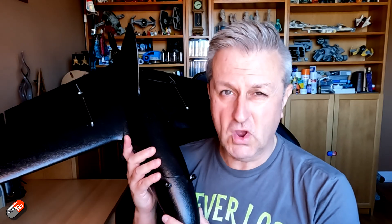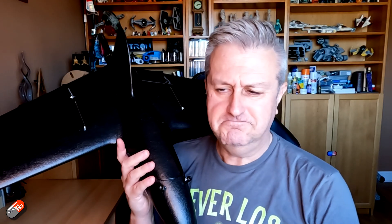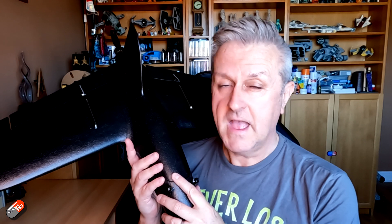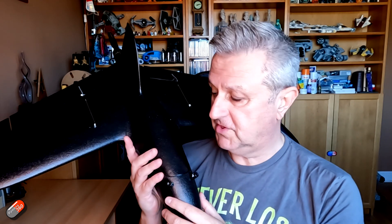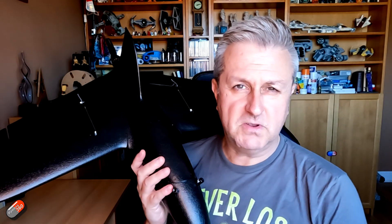It's one of the things I love about INAV - it means that my launches are safe and work every single time. Auto launch won't protect you from a really terrible throw, but if you give it a good throw into the air, it'll catch it and climb like, as my friend says, a homesick angel. The issue is that when you arm the model and it's in auto launch, you'll hear a beeping noise. And when you raise the throttle so that the system is ready to be thrown, you'll hear another noise, and while that noise is going on the prop potentially isn't responding to the throttle.